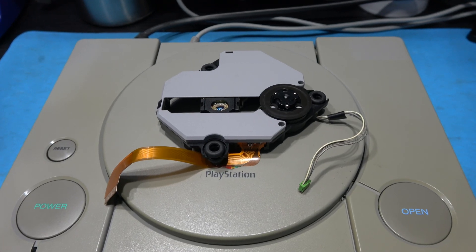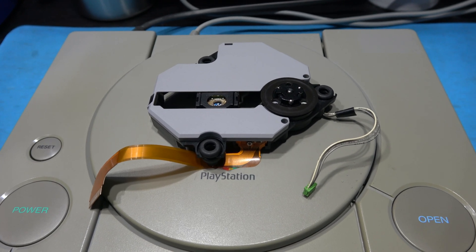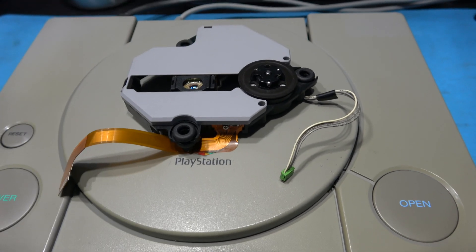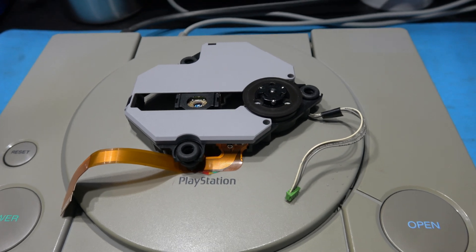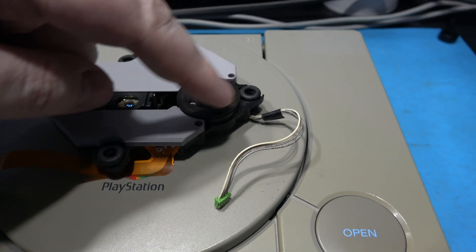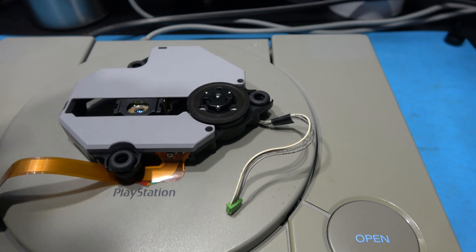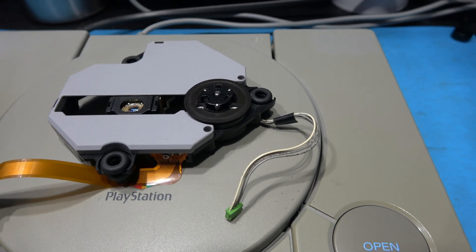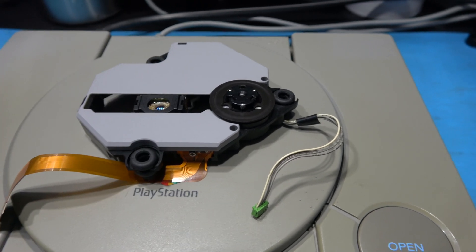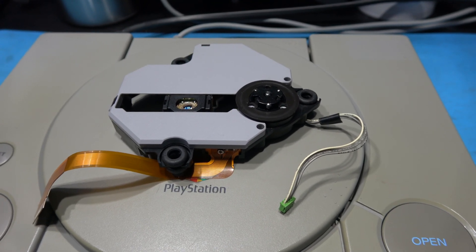You may be asking yourself what I'm going to do with the old optical pickup — am I going to throw it away? No. The optical side of this laser works perfectly fine. The only bad thing about it is the CD spindle mount that's broken. You can pick these up for about three to four pounds on eBay, they're very easy to replace. I've got a YouTube video of me replacing one of those — I'll put a link in the description. All I have to do is replace that and I can get this optical pickup back into service, because I know it works perfectly fine.